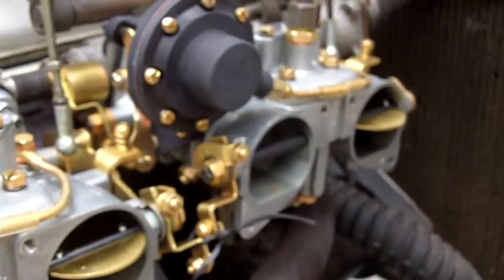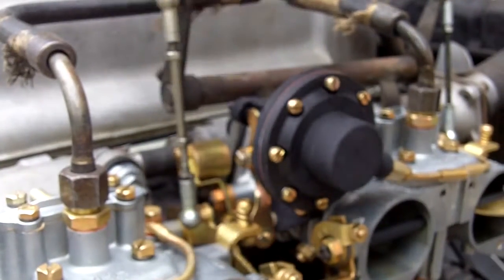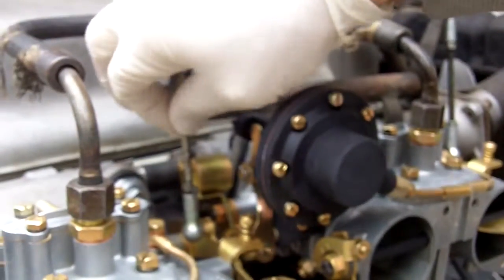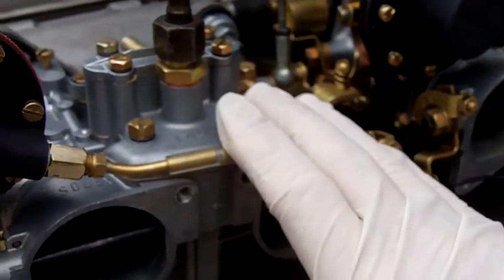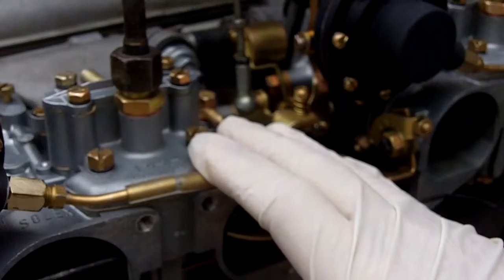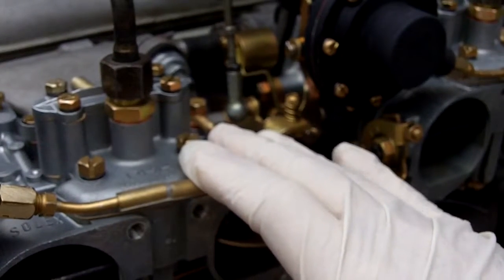Your responsibility will be to get all your linkage lengths taken care of, and at the very last you will be adjusting the linkage with the turnbuckle to fit the actual center-to-center. That's why there's a turnbuckle — so you can adjust precisely where you need the linkage to be. Fuel filtration is very important for these carburetors; they do not like dirty fuel. I recommend an extra inline fuel filter between the original fuel filter and the fuel pump.